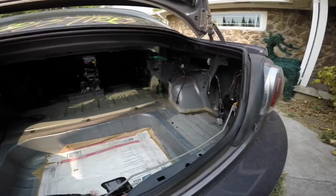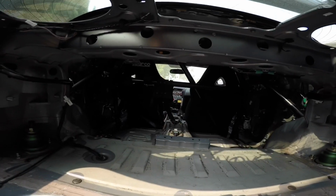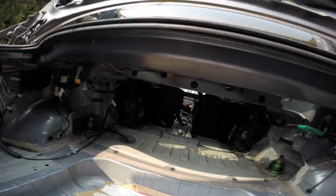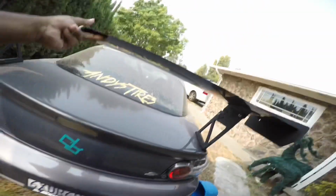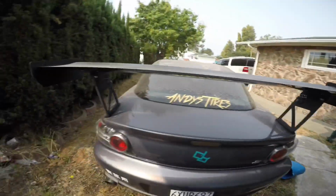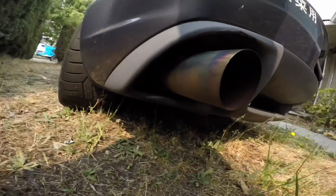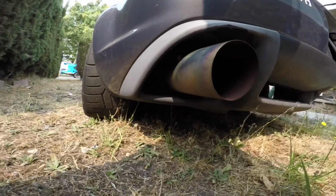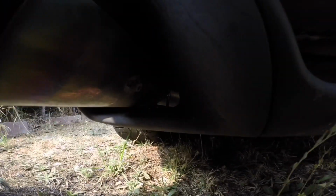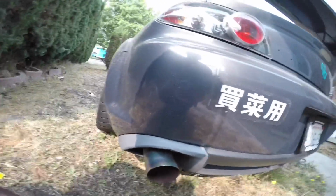But that's all good. And then we got the radio holders for the transponders and radios there. I mean, this guy had it really set up like a real time attack car. So it's really nice, really tight. The wing is carbon fiber. I know the ash and the paint on the top doesn't let you know that. But the other cool thing is right here, this exhaust. It is HKS high power. That's what was said, but it does have a V-band clamp. If you can see it back there, that V-band clamp can be used to take this tip off and bolt on a bigger muffler.